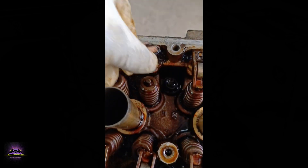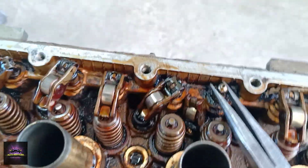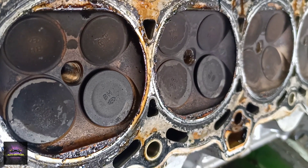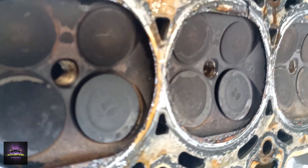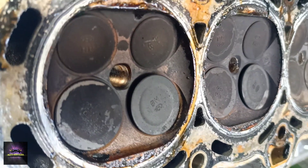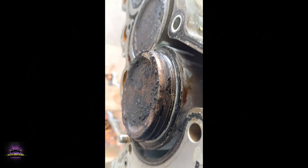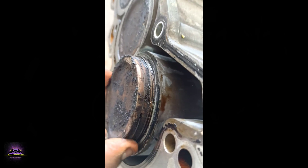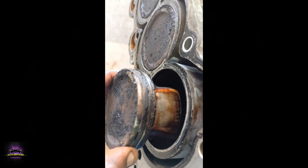For an engine with this kind of mileage, the sludge in here is significant — it looks like someone may have tried to clean things up before. The rockers have a lot of sludge, and the hydraulic lifters are definitely stuck. Look at the camshaft — valves on cylinders three and four remain open while one and two are closed. That's why we're getting no compression — these valves are bent. Even the pistons don't look good and the rings are stuck. Don't forget to like and subscribe — until next time.